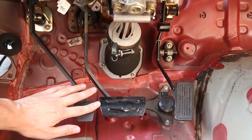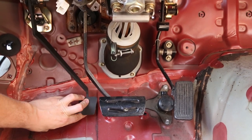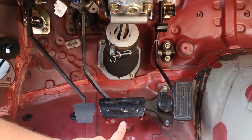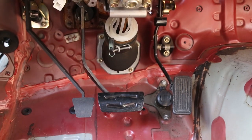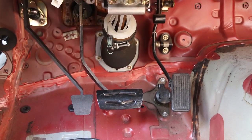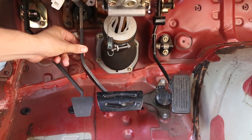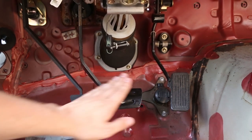So there we have my solution to the 3/4 inch clutch master cylinder situation. It's all bolted up nicely and the clutch pedal is about an eighth of an inch lower than the brake pedal. When I go to full extension it stops just before hitting the floor — maybe about a half inch — so I think it fits perfectly. I was originally going to cut down my brake pedal, but because the pedals are so close together I'm afraid I'll jab the clutch pedal and my toe is going to hit the brake pedal. So I just ordered the factory OEM manual transmission SC300 brake pedal assembly for $72 online, which should move everything over so I won't have problems hitting the wrong one by accident.